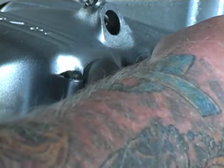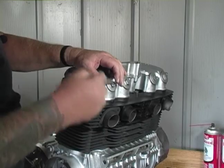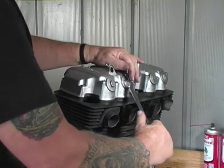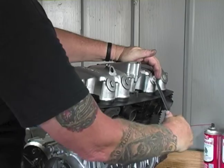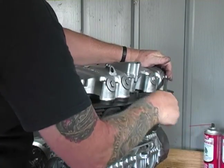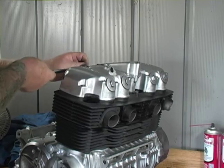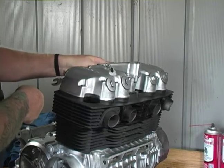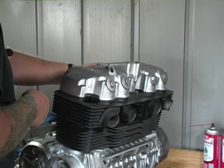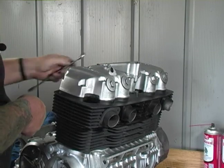We'll finish off by going to the back side of the engine and taking care of the remaining intakes. With all the tappet covers back in place and new O-rings installed if need be, we're just going to snug them down. In our videos you'll hear a lot about 'snug' and 'tight' — if you've been doing this as a mechanic you'll know what those mean. But when you're starting off and unsure, there's a torque spec for just about everything on your motorcycle. Get a good shop manual, get a good torque wrench, and torque everything — so you know you haven't exceeded it to the point of breaking something, and haven't left it so loose it falls off while you're riding.